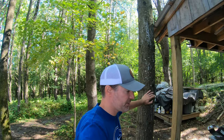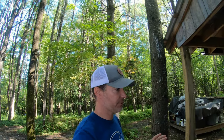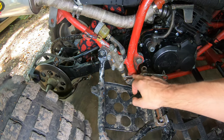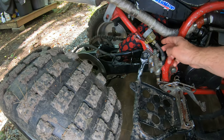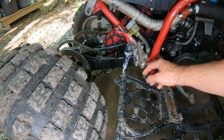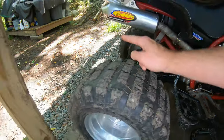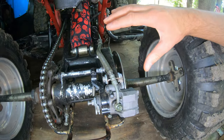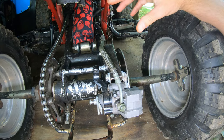We're doing another round with the blaster and the braking system. I fabricated a rear braking system from mostly Home Depot parts — the rear brake coming off OEM with a welded flat piece of bar stock, to a caliper and master cylinder that came off a 2004 Raptor 660. I cut a piece of metal, put it in, zip-tied the lines to this inch-and-a-quarter bar stock. You can see how I did all that in another video.